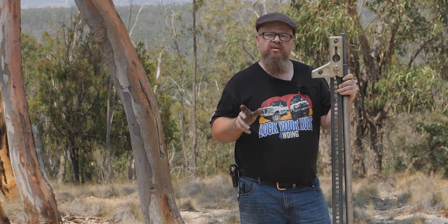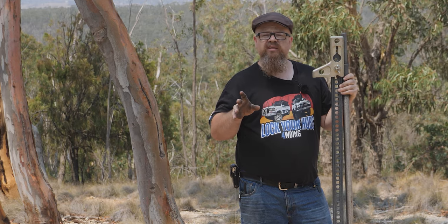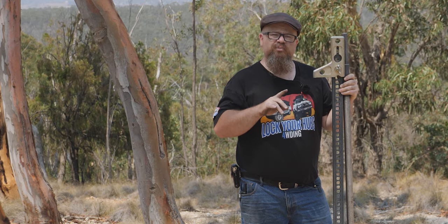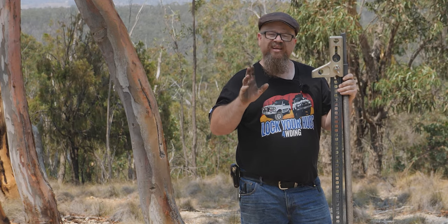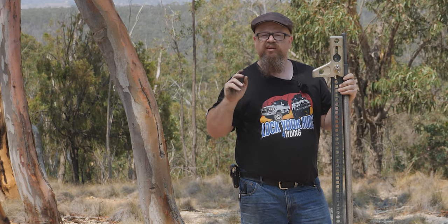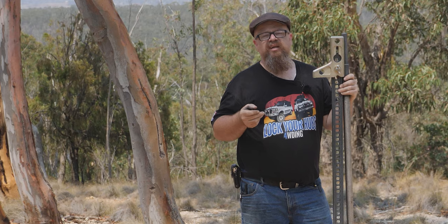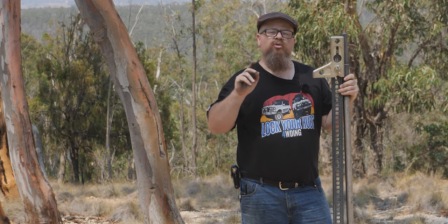Traditionally with an electric winch, you'd run from the vehicle to the anchor point — be it a tree or another vehicle — and back to the vehicle again. But this time we go from the anchor point (the tree), down to the vehicle through a snatch block, and then back up to the tree. That'll almost half the recovery load, but remember you'll only get half as far each time you travel the standard. That's with a traditional snatch block. If you're using the new-style snatch ring — the ones you use with soft shackles — it's not going to be quite as efficient. If you want to know more about snatch blocks versus snatch rings, click the link in the description or the link above.